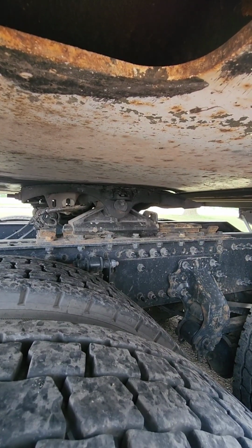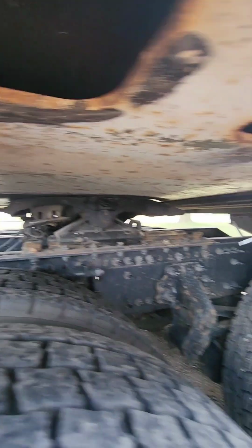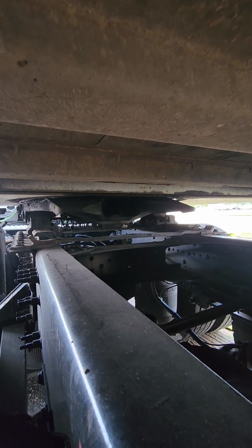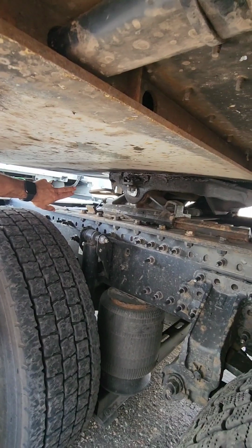It is not. Our locking jaw and lever, you actually have to check from the back side of your fifth wheel, looking through the trailer, and make sure it's properly wrapped around your kingpin, and also make sure it's not cracked, bent, or broken. It's properly mounted.